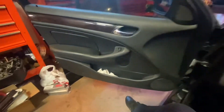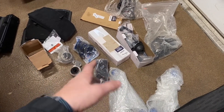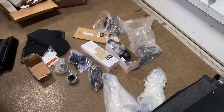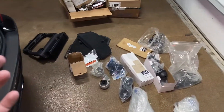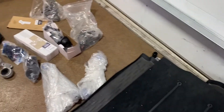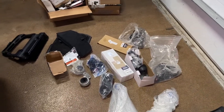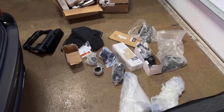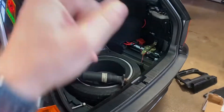This is kind of the first step into making this car nice enough to really command top dollar. After that — you probably saw a bunch of other parts on the ground behind the car — I'm going to be doing control arm bushings. All the ball joints feel good so I'm not going to be doing control arms. I do have upper and lower intake boots if I need them. The car really needs a CCV, might need a valve cover gasket, and originally last fall it was leaking quite a bit of fuel out of the injector seals, but it hasn't done that since. I also have a new OEM radiator, thermostats, and water pumps. I checked the dates on everything and the cooling system was done around 2016, so it hasn't done many miles since. I'll still probably put in an expansion tank, water pump, and thermostat just because it's so easy.